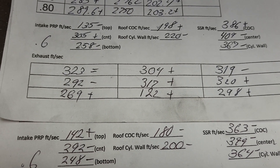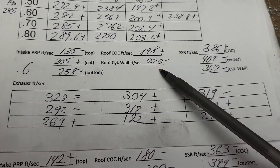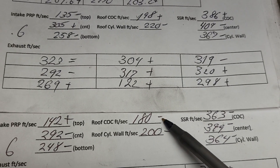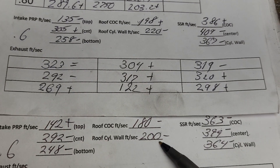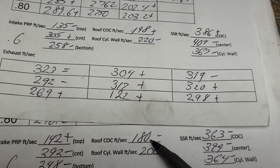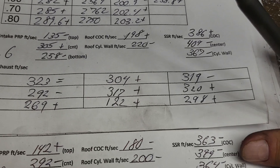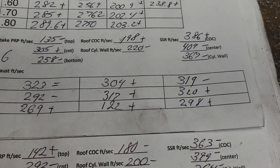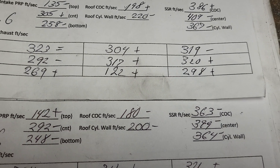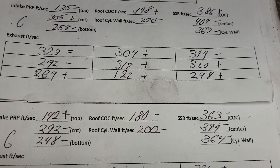You can do it the simple way and just put your finger in there and feel how much air is going past — that'll also radically change where the air goes, but sometimes it's worth it. A little feel gives you an idea of what's happening. As far as the roof of the port, we're off by 22 — not bad. We made the bowl bigger so we're going to drop speed on that side, and it also dropped the speed on the other side. I measured a couple other intake bowls and this was by far the smallest intake bowl.